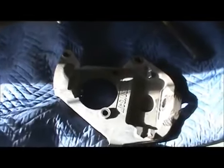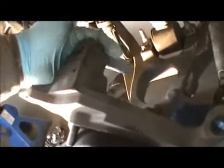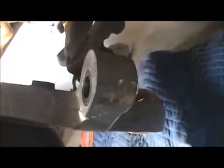The swivel, this is still connected. When you pop it off, it's connected down here like this to up here like that, and then this is still connected. So I come down here, I start whacking on the side there, won't come off. Put the nut back on, hit it, the nut from the bottom, because I'm gonna use a new nut anyways, and then it drops, boom. Once it drops down, you get your 19 millimeter and you take off the control arm.